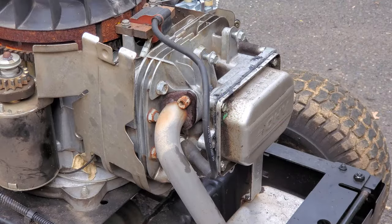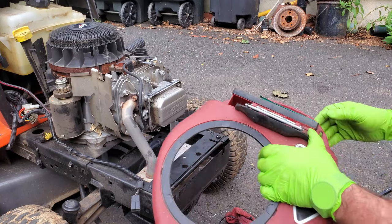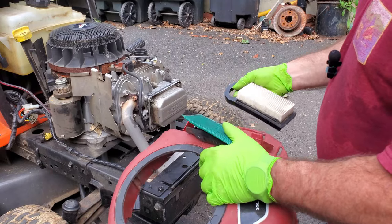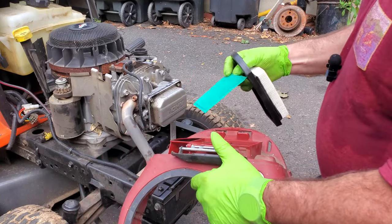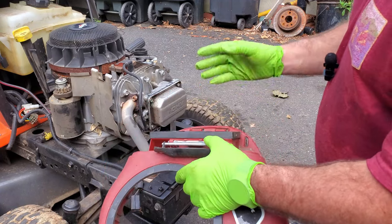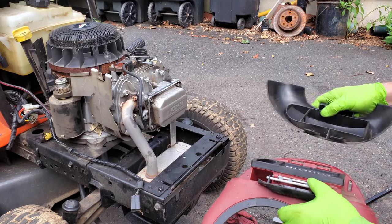So I'm going to get the cover and put the cover back on. I also took off the air filter cover — just to check — and this is how the filter was in there. This is a pre-filter. The air is supposed to go through here before it gets to your paper filter. The air goes up through here and comes from the inside through the filter, so the filter should go like this: the screen goes against your paper filter, then this goes in as your main filter. With the pre-filter on the wrong side, it wasn't doing anything. It's supposed to keep big debris out of your paper filter.